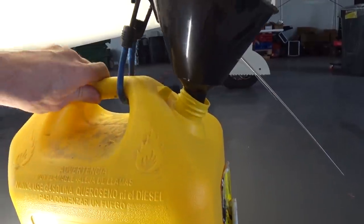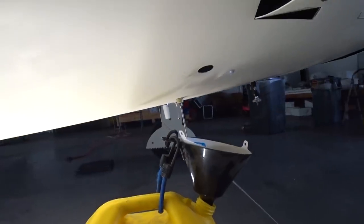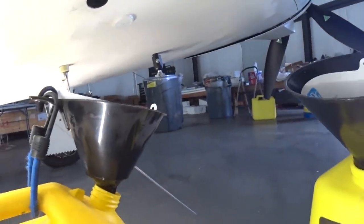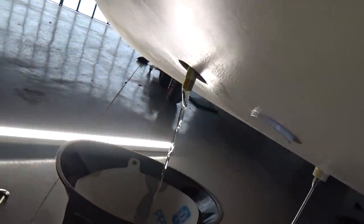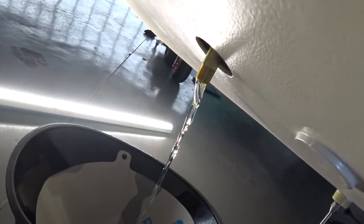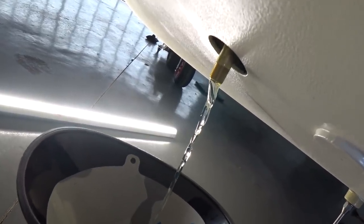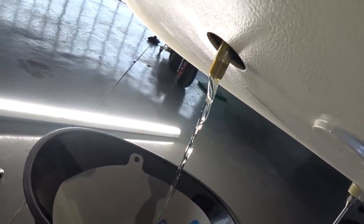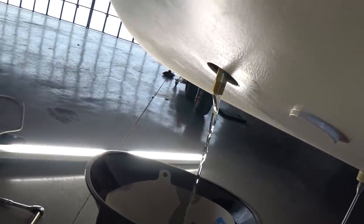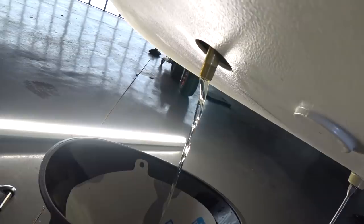I was the only one there and I didn't want to be spraying fuel all over the place if it got out of hand — I didn't think just putting the hose into one of the containers was a good option. I also needed to change out the drain valve because it was leaking a little bit. You can see it's just in such equilibrium there it doesn't even look real unless you bump the aircraft. I got all the fuel drained out and put a little nipple in there so it would drain cleanly, since some of it ran along the bottom of the fuselage the first time.